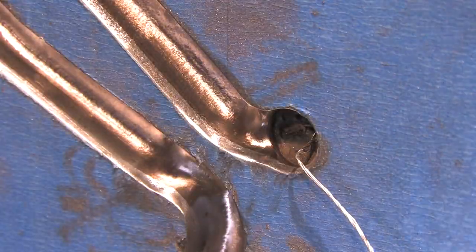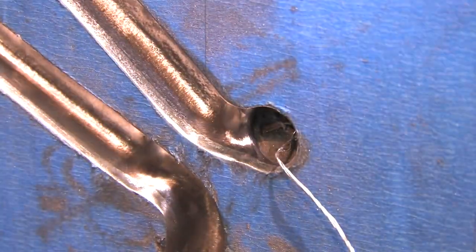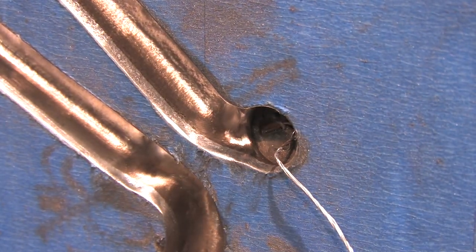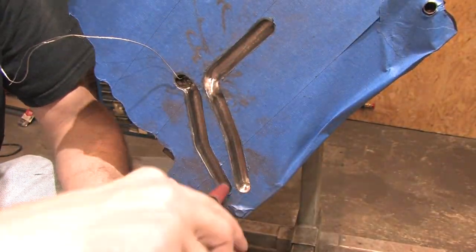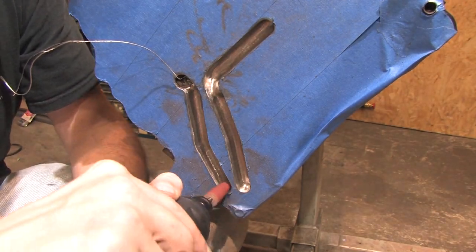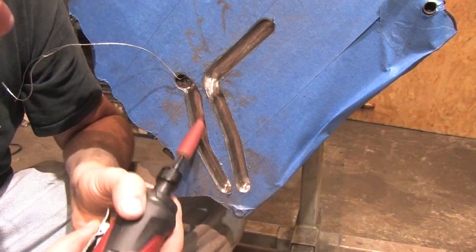I just want to create a slight low pressure zone just behind the opening of the bore to help pull the oil in by rolling in the sharp 90 gradually, about an eighth of an inch away from the number one hole, and lowering the height of the humps in the oil gallery. It lets the oil make a gradual turn into the block and doesn't decrease the oil level in the pan by much. Please take my own reasons as opinion. Based on how air flows, this makes the most sense to me.